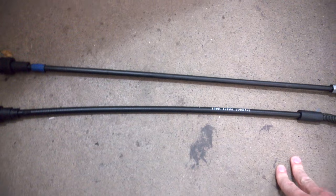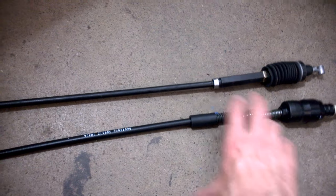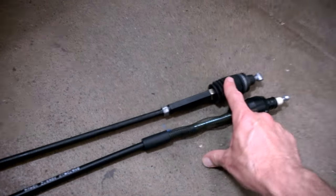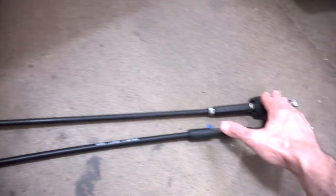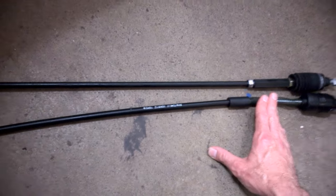Before we go on, I want to do a quick PSA. I didn't have any luck installing the first cable — it wouldn't reach all the way. It's not that it wasn't long enough; it just couldn't pull back enough. I've got a new one from Mopar — Chrysler Direct. The one at the top doesn't have a spring; it has a couple of set screws and a rubber boot. I tried to set that up and it didn't reach — I couldn't fit it into the fork and pull it back enough. So instead I paid considerably more and got the real one from Chrysler that has a spring you can pull back. The lesson here: cheap aftermarket cables aren't worth it. I spent a day or so filming trying to get that one to work. We're going to send it back and use the proper one. Just pay a little more, get the real spring and the real cable, and you'll save yourself a lot of trouble.